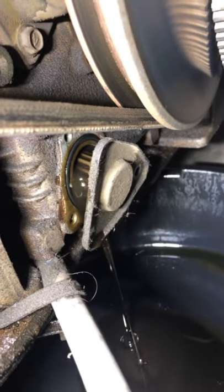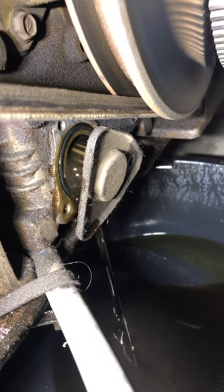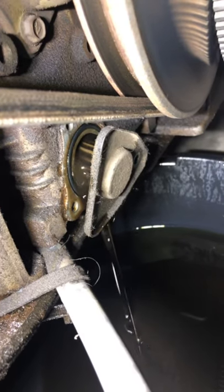You'll see I've got these three bolts out from below the machine. It's a little dirty so it's caked on there, so I'm gonna get a little pry bar to pull that off. Here's what the bolts look like — there are three 10-millimeter bolts. I've got a little screwdriver to pry against this to remove it. You'll see now the oil is starting to drain out. That oil is in terrible shape. There's also a black o-ring on there — you don't want to lose that. You'll need to either reuse that o-ring or get a new one, and I highly suggest you get a new one.